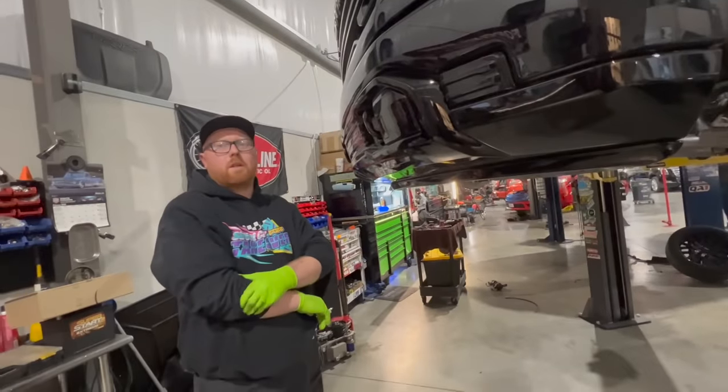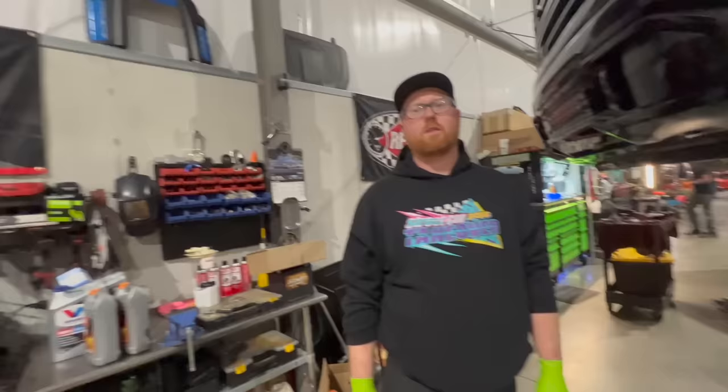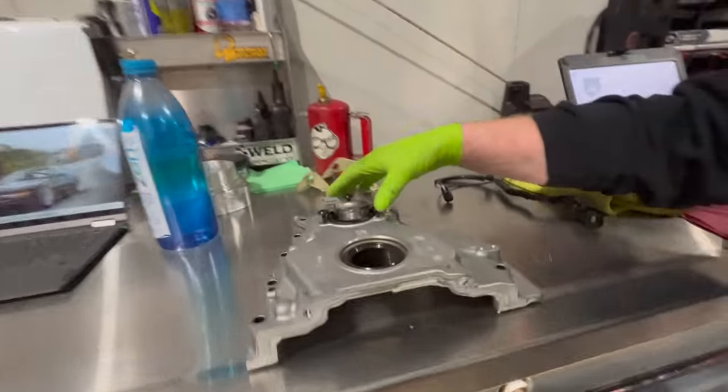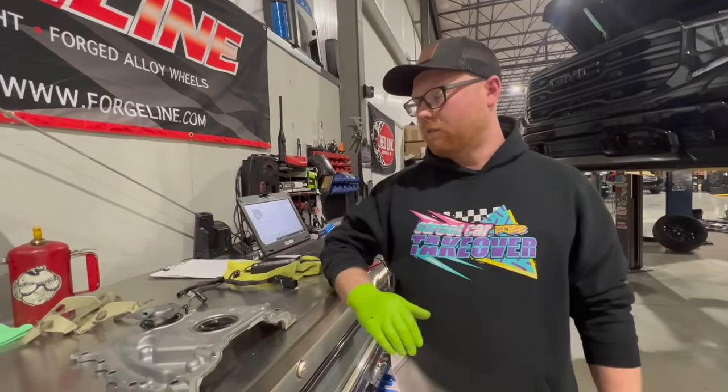And then you gotta do these brakes. Yep, get the brakes bled. But yeah, I checked the harness. Everything's in the same location, so I don't know if it's gonna change much, but we'll try putting on the VVT solenoid and plugging it in just to see if that makes it happy. Okay, this is the factory 5.3 front cover.